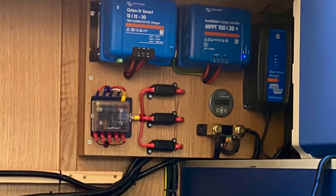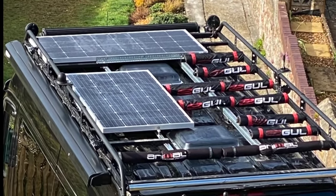100% — but also the charging rates. Having the Victron units in there — the MPPT, the mains charger, and the battery-to-battery charger — enables lots of power to be transmitted through to lithium batteries. Lithium can accept a lot of power over a short period of time — they're more sponge-like. There's no resistance and they can take a really big, long bulk charge. That's how you capitalise on sunshine, or your DC-to-DC giving out 30-odd amps. Technically you could have 40-plus amps coming into your battery, whereas lead wouldn't allow that for very long without damaging it.